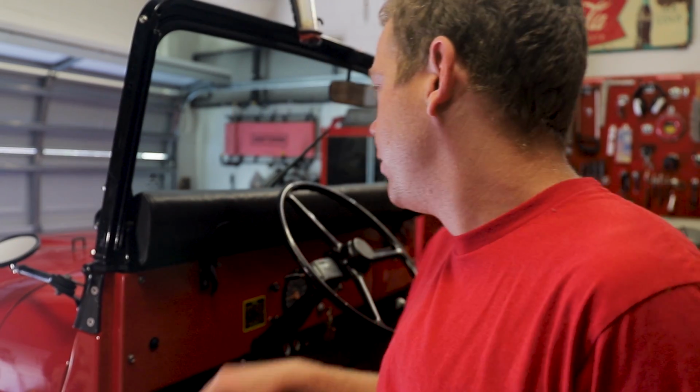It had the dash pad, it had the right leaf springs, it had the right rear axle, it had the roll bar, it had the 10-inch drum brakes. I think that's it. The only things it was kind of missing: it has the bigger steering wheel too. The steering wheel was, I think, bigger on the Renegade 1s. The only thing that's missing is, I believe, the 15x8 Kelsey Hayes wheels. It doesn't have those. I'm assuming these wheels were the original wheels and they're just like the normal 15x7s.